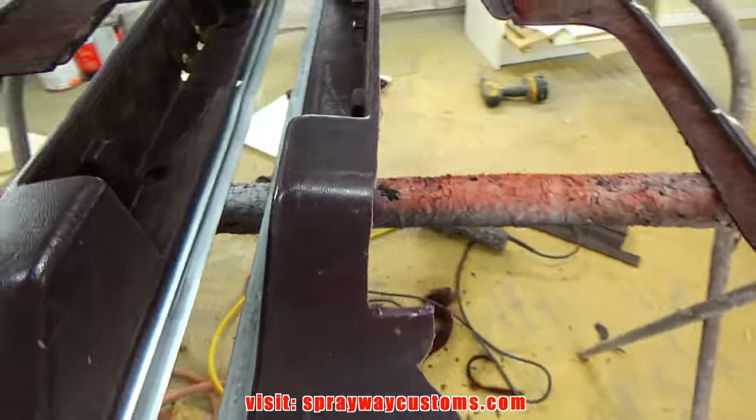I'm just trying to remove the guide coat, that's about it. And it's going to show me all my low areas, my imperfections. Let me remove some more so I can show you. It's pretty flat because you don't see any guide coat right here, but you still see some here and here. Those are low areas, but it's gonna come down once I continue blocking it.